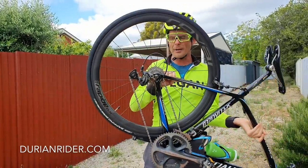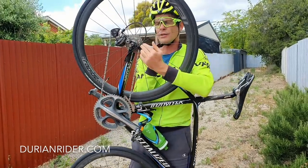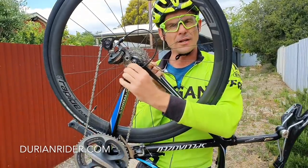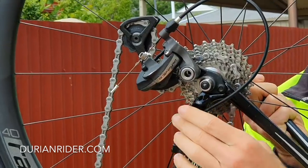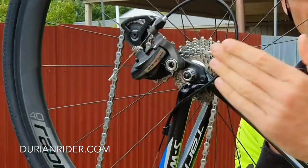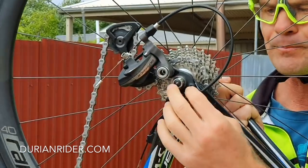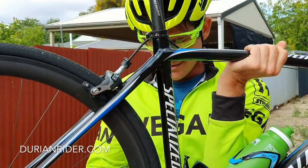The fifth most dangerous part is if you've cracked the chainstay — if that snaps and you're in a sprint, your back wheel can warp out and cause a crash. I can feel that now, there's no cracks in there. I had a friend back in the day on his Cannondale Cad 5 — they were famous for cracking around there and actually failing in a sprint. He snapped his collarbone. I'd warned him to check it but he didn't check it soon enough. He did get warranty on the frame — that was the consolation prize — but he did break his collarbone.